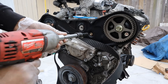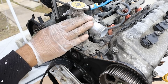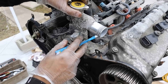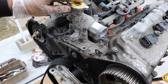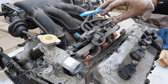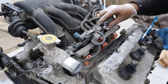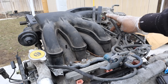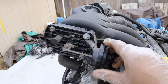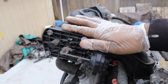Now I'm removing all the bolts for the upper timing cover backing plate — it's nice and loose. Next up I'm removing this coolant outlet. This inlet is actually attached to a bypass hose that goes across the other side inside the V-bank. Moving to the top of the engine, you can see the fuel rail and this vacuum mess of a manifold. Over here at the throttle body there's a vacuum manifold that actuates a little cam to adjust the flaps inside. There's another one on the side — this is all part of the acoustic air induction system; I've got another video on how that works.